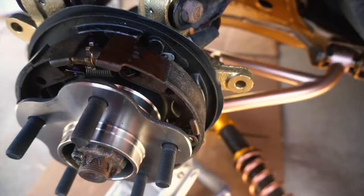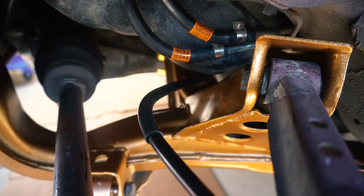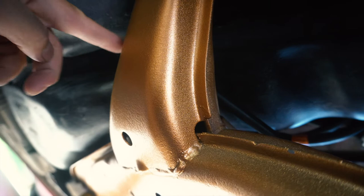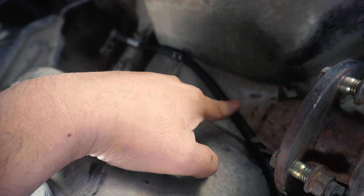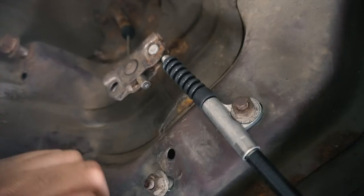Here is where the e-brake line originates on the brake assembly. The way I routed it was through here, under the traction arm, and it coils around where the original bracket location is. The cable goes through and exits out on this side. To make the e-brake cables work with my setup with the Part Shop Max knuckles, the e-brake cable will have to crisscross — it'll hit this clip, go crossover, hit this clip, and then fasten down to the OEM location for the S14 e-brake cable's front.